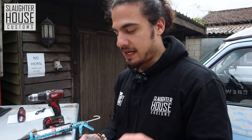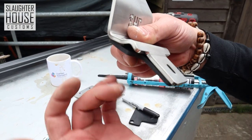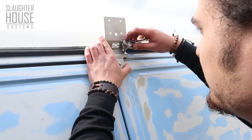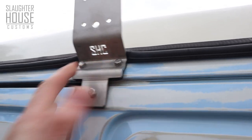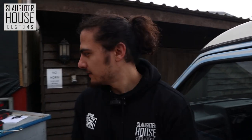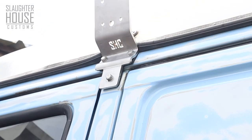Now we're going to take our rubber pad and one of our brackets, and essentially you're going to sandwich it onto the bodywork with the rivnut. So just roughly get one in there, screw them in a bit. Take your 10 millimetre. That's the first bracket on. Now it's exactly the same procedure for the next one, right? Exactly the same. And with the power of cinema...